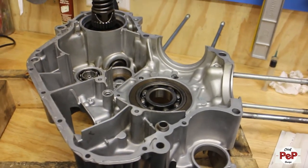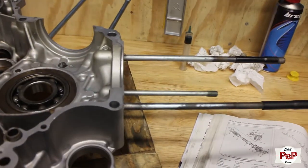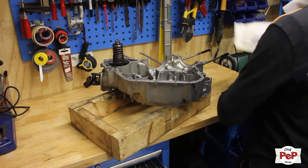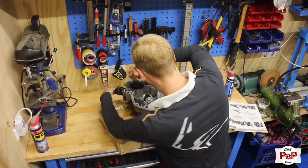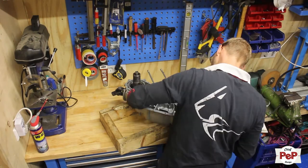The shaft gear housing is something you don't want to disassemble. It's very hard to get there and you require a lot of special tools. You work only with the left engine half — this is where you place in all the gears and crankshaft. The right engine half will be the lid on the end. First I cleaned all the bearings I didn't take out before the wet blasting, and I cleaned every last trace of dirt or filth.